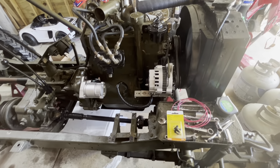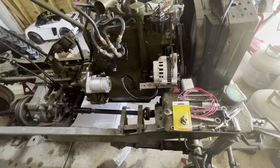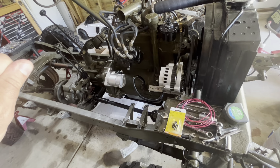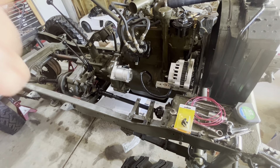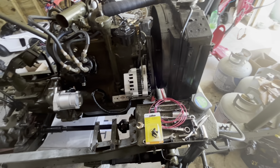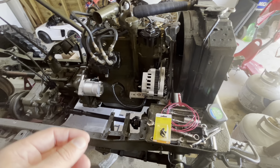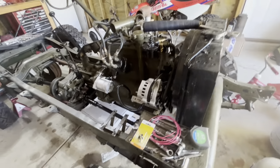What I'm going to do is go ahead and start wiring up a test wiring harness. We're going to hook up the starter, the alternator, everything - hook a battery up, then hook our key switch up that I purchased as well, and then just crank over the engine to make sure the starter is functioning properly. We're going to hook some fuel up to it once we get everything wired up, and I want to test and make sure this alternator is functioning properly. We should get anywhere from high 13s to low 14s voltage out of it, measured on the voltmeter.